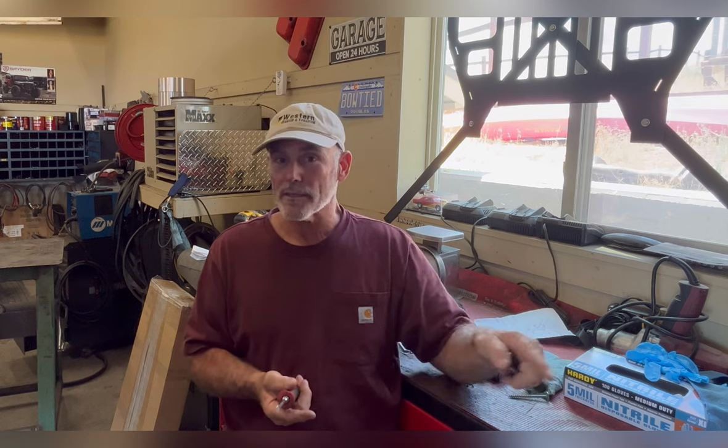And you could also use feeler gauges or a bolt or a screw, anything that's magnetic, anything that would create a pulse on that magnetic pickup would then send a signal to the module, and the module would drop the field in the coil and you would get spark. It was kind of a quick test method to kind of see what's working and what's not. If nothing happened, then you had to go into the real diagnostics. But if you could do that and you were getting spark, then you could move on to another point of reference. It was just a real quick test. Well, fast forward 20-something years later, I figured out you can do the same thing on the crank positioning sensor on these LSs. Something's not working, like no spark, no fuel.